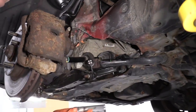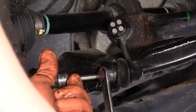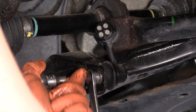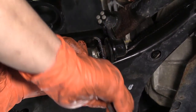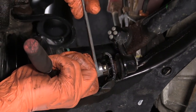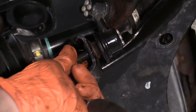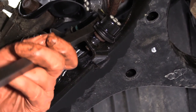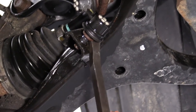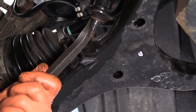You'll need a 14 millimeter wrench and a number five Allen socket. I'm going to put the 14 millimeter wrench on the sway bar link nut, and then install the Allen head in the stud with the cutout, and loosen up. If you get to a good spot and feel like a ratchet wrench is going to work, you can move on to that. Take the Allen head socket off and you should be able to get this right off. I'm going to take a pry bar and pull that right out of the cutout.